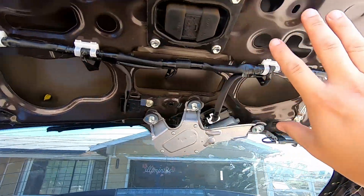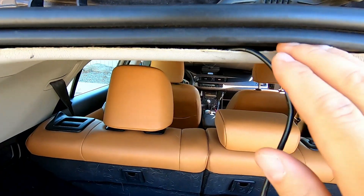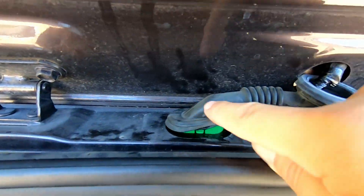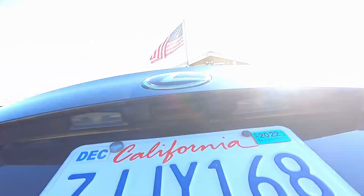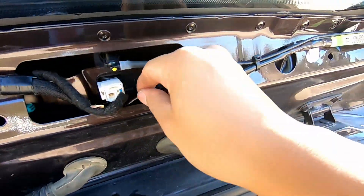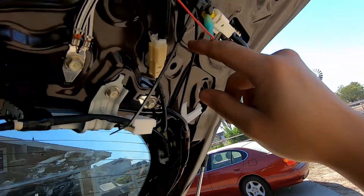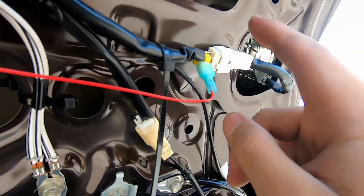All right guys, it's the next day. I removed this whole panel here - it just comes off, it's just a bunch of little clips, pretty easy. What I'm going to do is feed this wire under the headliner and then feed it through, so it's kind of like an OEM style. We're going to feed the camera around and mount it somewhere on this side. After a while I think I got everything - you can see it's fed through real nice, zip tied everything, and it follows the original harness. I bundled it here, zip tied it, and tapped into the reverse light. Hopefully it works.